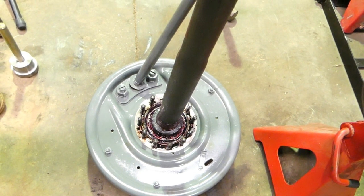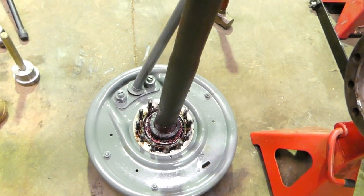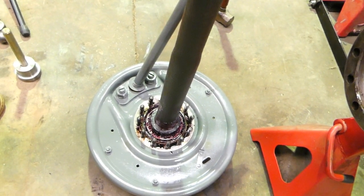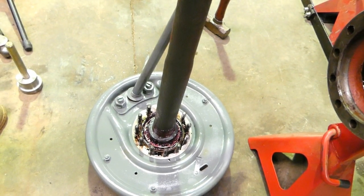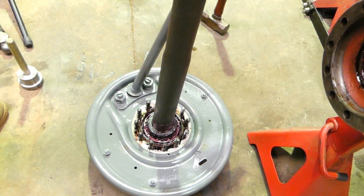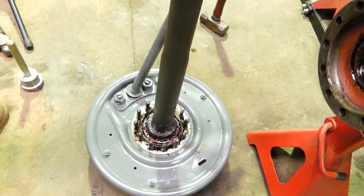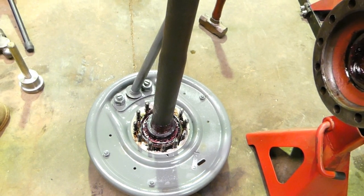And you'll also notice that I've actually painted the brake backing plate. This tractor did a lot of slashing or topping in its time, and both backing plates were very peppered, sandblasted, and particularly the right-hand side one, as from the top of a slasher, they often go anti-clockwise. And so the right hand backing plate really cops a hiding. So both of them were very poor, so I've sandblasted them and just put a little bit of paint on at this stage. And look, it was just to stop rust after I'd painted them.